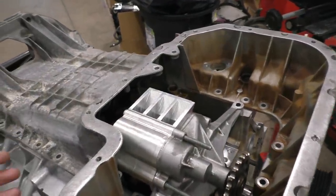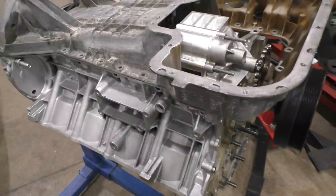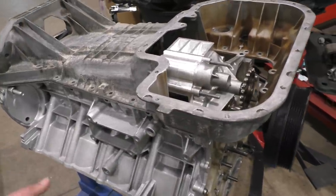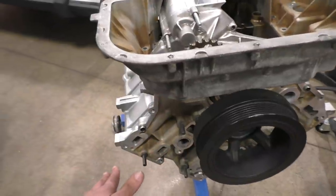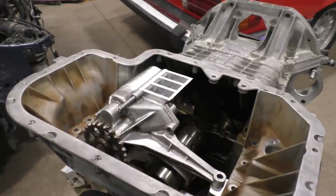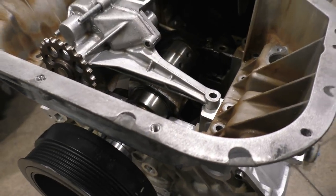Oil burning problems like I was having in that car: after a few laps there's so much oil that pools up in the heads that oil literally starts coming out of the valve covers, just because of that much oil accumulating in the heads, just because it's a 90 degree V8. When you're cornering above 1G, oil doesn't really flow down these galleries, it goes up these galleries. So really excited to see how this will perform now when the whole engine is put together and working.